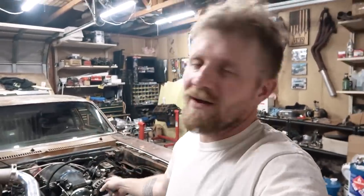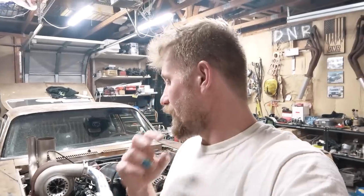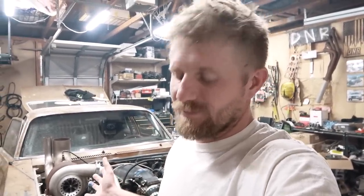I wasn't done — it was bugging me, so I disconnected the throttle cable and that's all it was. I just have to adjust the cable and it idles like it's supposed to. We've got a little bit of popping and banging and some things to figure out, but it's back to life. I need to take a break — I haven't been feeling the best the last couple of days with some stomach issues. Once I collect a full list of what's left to do, we'll get it right and take it out for testing. Your boy is out.